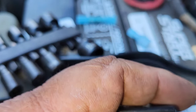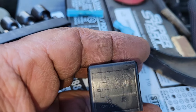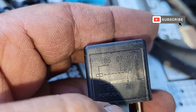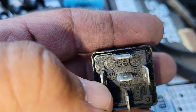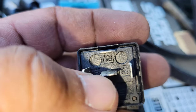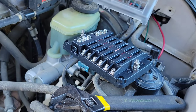This is telling me that if I don't want that, I can put it on 87. There's that little blade right there that doesn't touch 87, so that tells me there's no power there unless I power up the electromagnet by adding current to 86 and 85. If I run electricity through here, the electromagnet will come on and the blade will jump from 87A to 87, thereby jumping power from here to here.